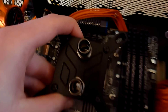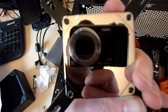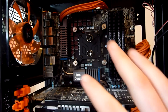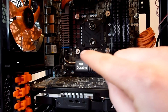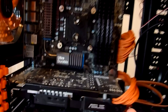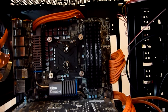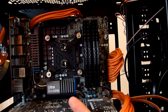I will be following the instructions and look how shiny it is. Okay guys, the block is in. How I do this is follow what the instructions say, but also from personal experience: once the block is on, tighten to the opposite side, just finger tight, then go counter-clockwise one turn, keeping an eye on the motherboard to make sure there are no twists or strain. You can buy optional backplates to distribute the pressure slightly better — I didn't go for that option. But if you're not confident, make sure you get the backplate; it's a lot harder to break anything that way.